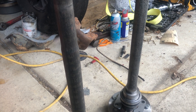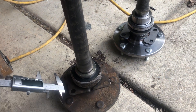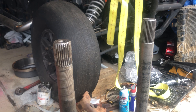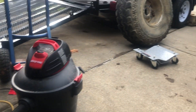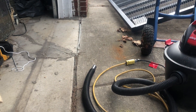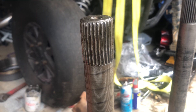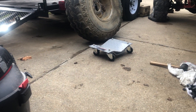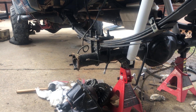Let me know if this helped you decide. You're definitely going to want to upgrade your axle shafts if you're pushing high horsepower and drag slicks on the 9-inch, or you're pushing big tires. These were 37s — very bald, about a 36-inch tire now with how bald they are — and they were almost bending these splines. These were the stock shafts from the Bronco from 1977, so that could also be a factor. But if you want to run bigger tires, I would definitely recommend going to the 31 spline.